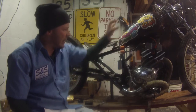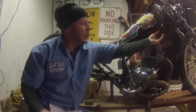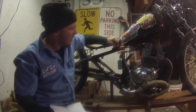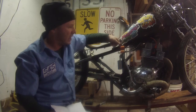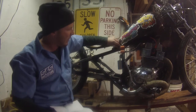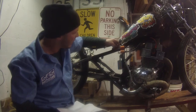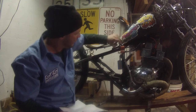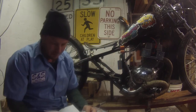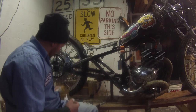They're just aftermarket. I decided to put them here instead of up there because it's hot up there. The wind will get at this. It just looks cooler here. That way, if anything happens, spark or whatever, or like riding, I can just pull a coil. I don't know if I'm going to put them on a toggle switch, but it's easier than wiring up a kill switch or anything like that. You just got to be careful so you don't pull them out with your leg. I know it's a little close to the kit, but I paid like $20 for them, which ain't too bad.